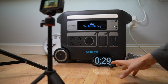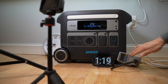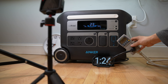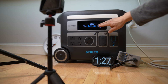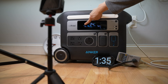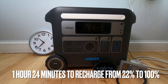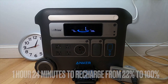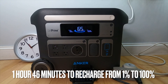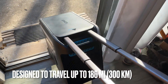I'm recording a time-lapse using my GoPro to see how fast it can recharge. The power input reads a bit differently — my Kill-A-Watt power meter shows 1269 watts while the display shows 1348 watts. It estimated 1.3 hours to fully recharge. It took 1 hour and 24 minutes to recharge from 22% to 100%. In my second test from 1% to 100%, it took 1 hour and 46 minutes. The wheels are awesome — they can easily roll over small obstacles and seem very durable.